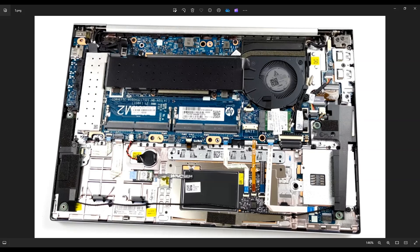This computer takes DDR4 25600 RAM, and the max RAM capacity for this computer is 64 gigabytes, as far as I know. I've always told people maxing out your RAM is a great, cheap, easy way to help your computer's speed and performance — I think everyone should just max out their RAM. And as I mentioned before, there'll be RAM replacement and upgrade options in that link below in the description.